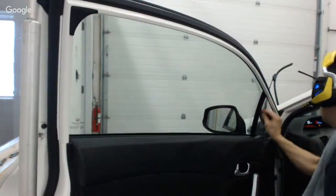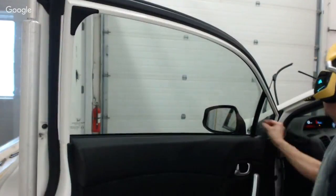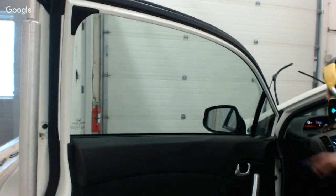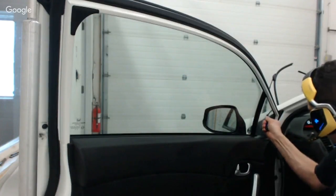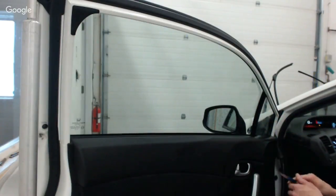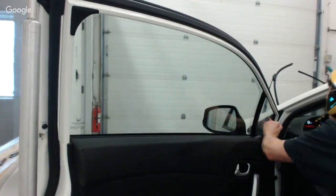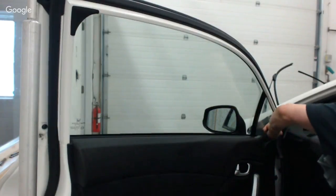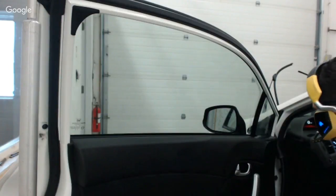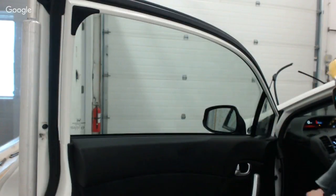And there's a science involved with paint protection film too. They're constantly trying to find what adhesives will hold the adhesive that touches the surface onto the film better, so that when you go to take it off, you're not leaving all that adhesive on the paint. Because now you've got to scrub and do all these things on the paint.